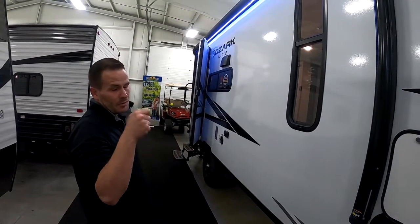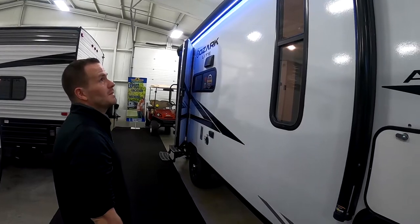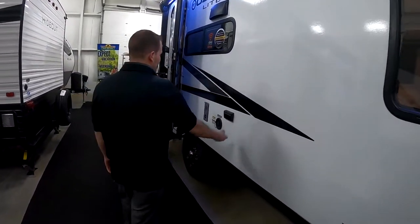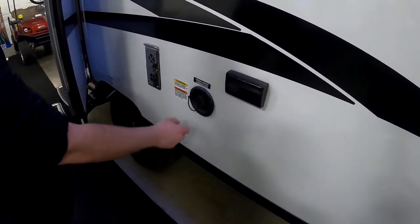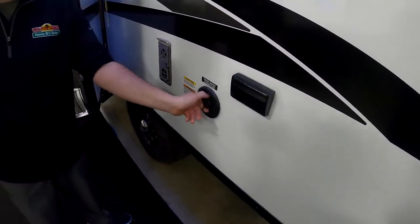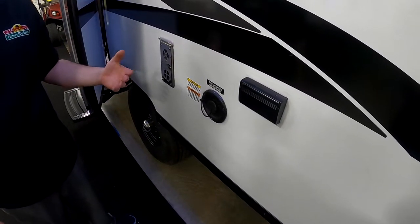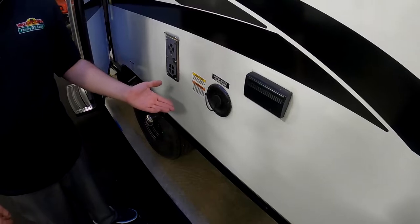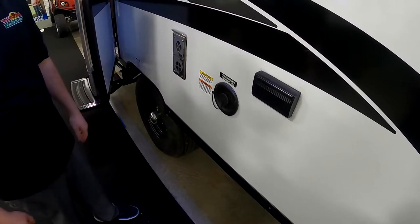And forth with the power drill to get it back in to get to the service facility if you had to. Of course, got awning lights that you see. Got 12-volt plug-ins on the outside here for whatever you'd like. You have your fresh tank fill. So this is going to be one access to water that you have. You can fill this tank up before you leave the campground or before you leave your house. If you're going somewhere that doesn't have a city water full hookup, use your water pump and turn that on the inside. You have an unlimited water supply like normal.